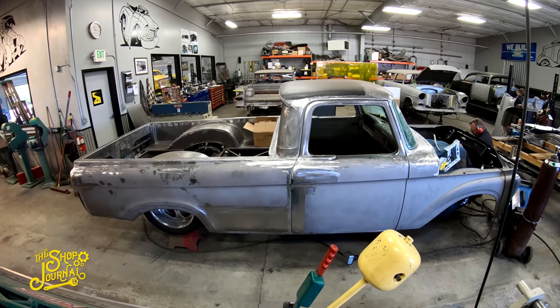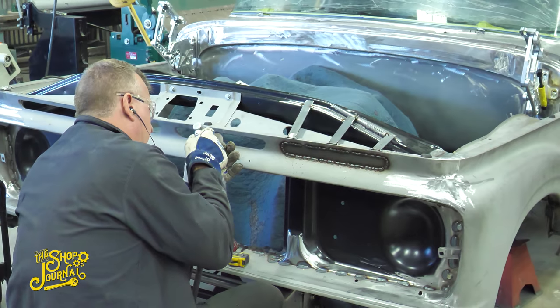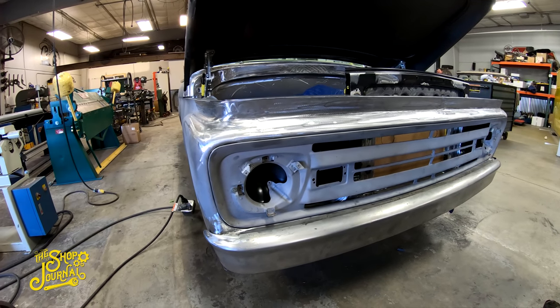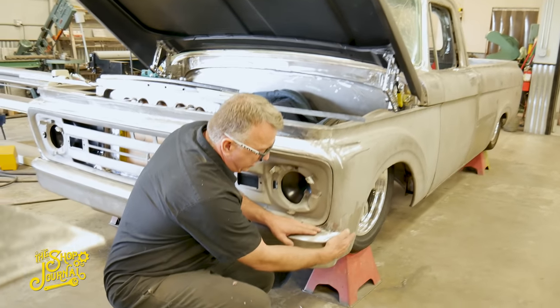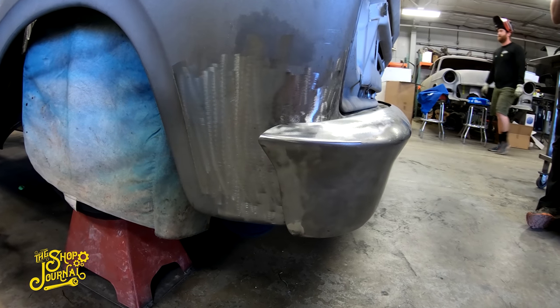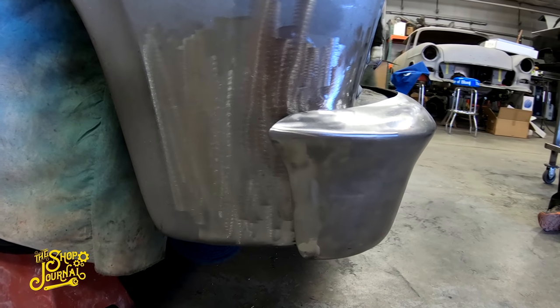Here we have the Ford unibody. Since the last episode I've been working on the front bumper area. The bumper is all smooth — no license plate frame, it's tucked in and cut down a little bit. The ends have been curved in to fit tighter to the truck. There's a body line here that's been hammered and dollied out, and the bumper has been cut down with a little point to give it some character while keeping that old truck look.